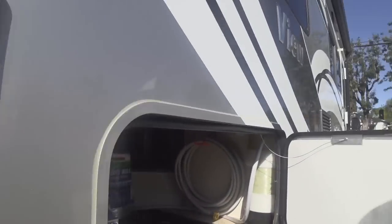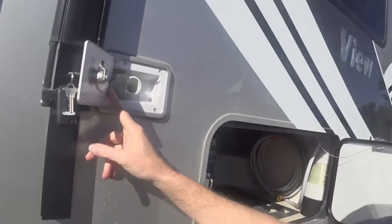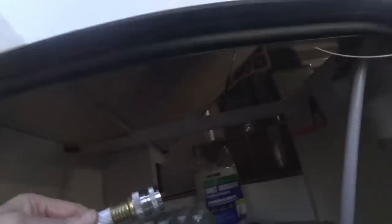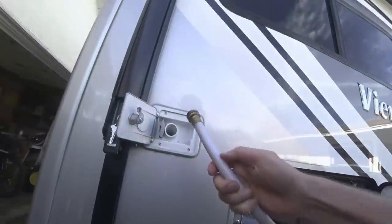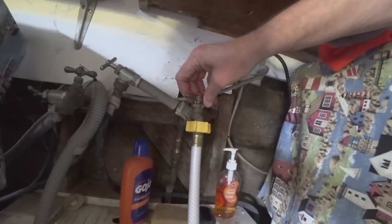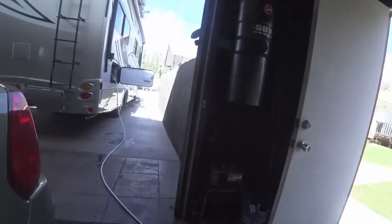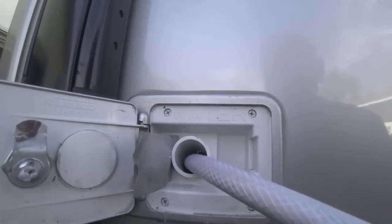I like soft water, and that's why we use our gravity fill tank — I have a portable water softener installed in the rig and we use that to fill up our water. We take the fill hose with a quick connect and just plug it right in. The output of the water softener is on a short four-foot piece of hose. That hose just goes into the gravity feed. Now we're ready to turn on the water and fill it up with soft water. The water goes up into the water softener, softens the water, then out and into the fill hose.